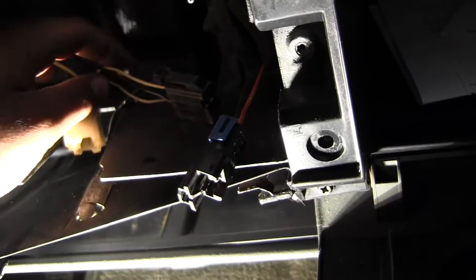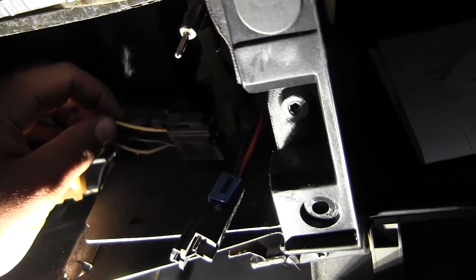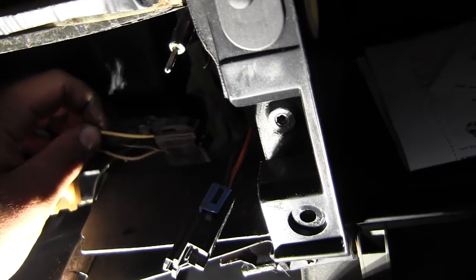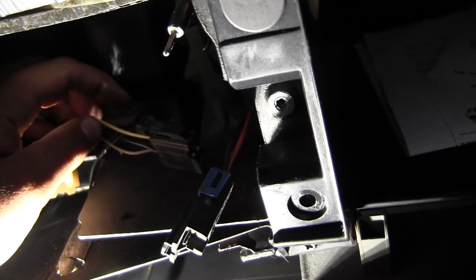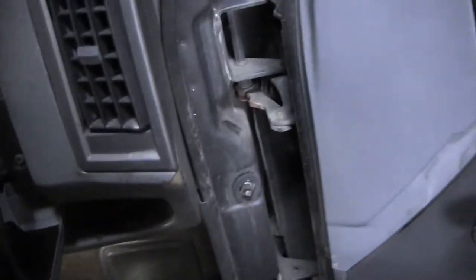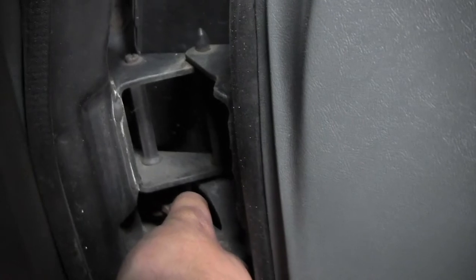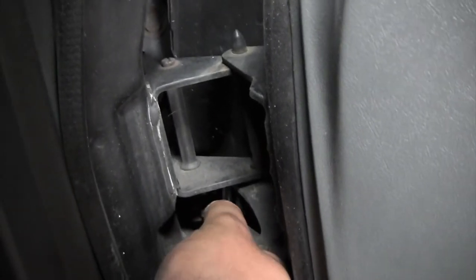I'm gonna make sure that I have constant 12 volt positive here. I have negative here at the black wire, which I'm very positive it will. I'm gonna have a switched wire, so every time I turn the key on, I have power here, and when I turn the key off, there's no power here. So on most vehicles, any piece of metal should be grounded through the battery. So I'm gonna pick right here. It's a little bit exposed, these alligator clamps will bite into the paint a little bit, hopefully.